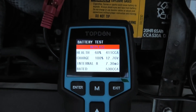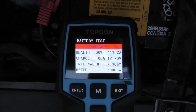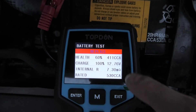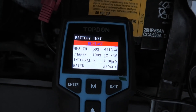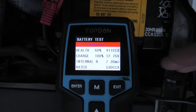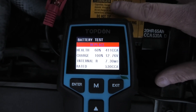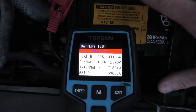Rated at 530 CCA, even though the device advises us to replace the battery — which is actually a good idea — we won't do it right now because we still have 411 CCA, which means we can easily start the vehicle, especially in a warm climate. In cold climates, this can create problems and you may not be able to start the vehicle. The health will slowly go down, and in a few months the CCA will be lower until at some point you won't be able to start it. You can either keep it and be ready for it to die, or replace the battery. If you keep it, I would also carry a jump starter with you, just in case.